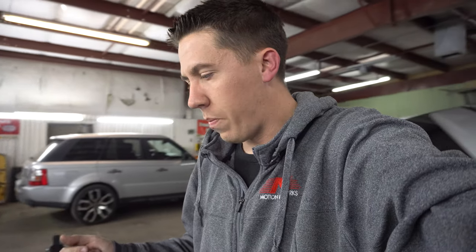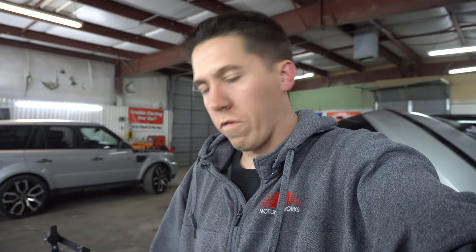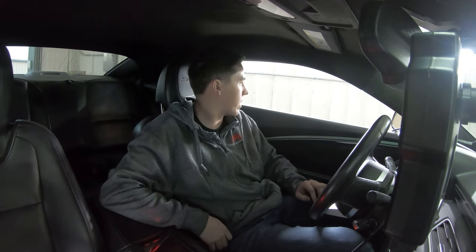I'm going to rev it out a little bit more. Went ahead and found the rev limiter with this having a cam in it, so I raised that up a little bit. If you take the stock number — this thing was supposed to make about 430 horsepower — take 18-ish percent away for drivetrain loss, that nets you somewhere around 360 to the wheels. And this on the last pull made 453, so it's almost picked up 100 horsepower over stock, and it has 150,000 miles on it. Another pull or two and we might be good.